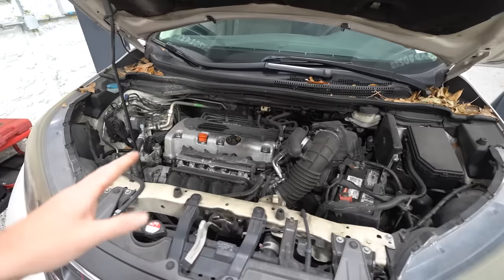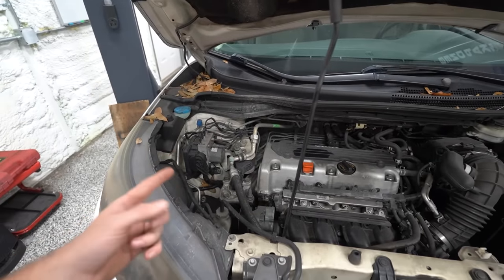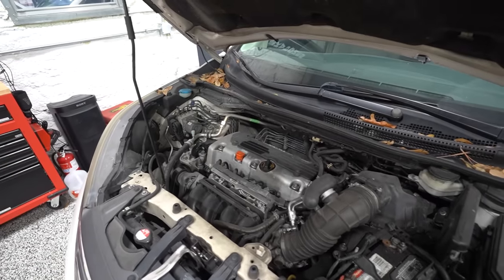We were able to get the price down a little bit because of the issues, and we ended up picking it up for what I felt was a really good deal based on what I'd seen looking for these for a solid few weeks. So we got it home, and the very first thing I tackled was the AC. On the drive back, you could tell it was definitely low — it wasn't just that it needed time to cool off. It took about half a can to fill it up. Time would tell if this was a simple problem — if it was low again in a week, bigger problems. Fortunately, it's been great ever since. Just an older car that had slowly leaked Freon over years and needed to be topped off.